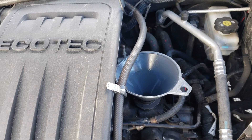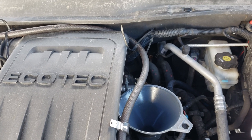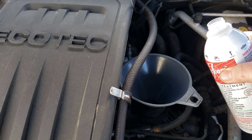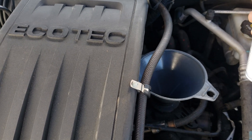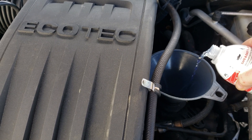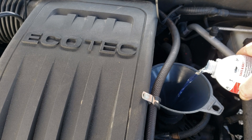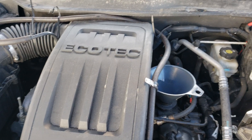While we've got it going to flush it out, we're going to add four and a half to five ounces of Sea Foam to help with the flushing process. I don't have any small liquid measuring tool so we're going to use the old calibrated eyeball - this is 16 ounces, so it's like one, two, three, four, five and a little extra. According to Sea Foam's guidelines on the back of the can for adding to engine oil, they want you to put it in 100 to 300 miles before you do an oil change, and that will help keep things clean and get all the gunk out.